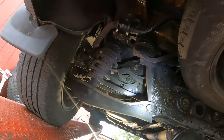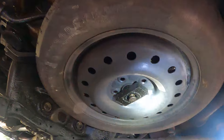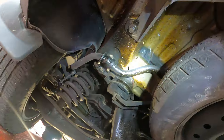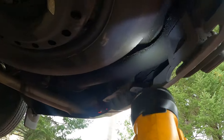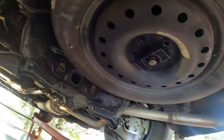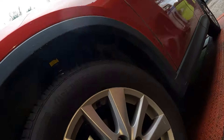See the rear cross member here - it's still got a really good coating on it. It's got some wash off from road spray, but all the suspension has at least got a film layer on it. The spare tire has got a film - spare tires always rust, you can drop that down and spray above it. The receiver hitch - you always see rusty receiver hitches - I spray those, that's got a good coating on it. I'm going to go ahead and spray this car and get it off the rack.